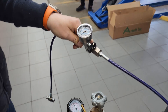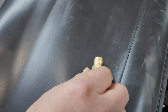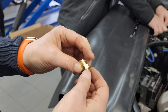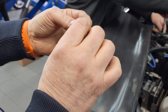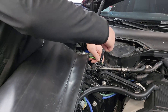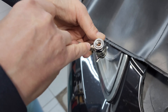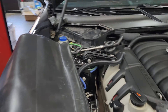Our nitrogen equipment consists of an 80-cubic-foot nitrogen tank and really high-quality oil-filled gauges — US-made. Here's the adapter, made in Germany. While it looks similar to a tire valve thread, it's actually a high-pressure valve inside with a conical fitment surface, so when it goes on the fitting on the car it's very tight. This valve allows for a tight connection, and because these are all high-pressure joints — even though it looks like a tire valve fitting — there's actually a copper washer inside.